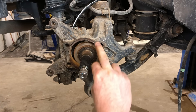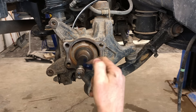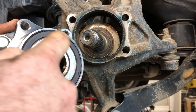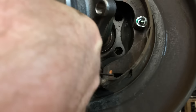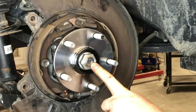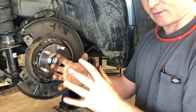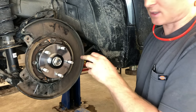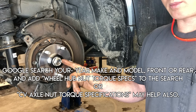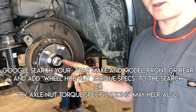Clean this hub out as much as you can, and then I like to clean up this flange right here so that you don't cause any alignment issues if you get a piece of rust stuck under the new hub. I like to use a little bit of grease — a little bit goes a long way, a dab will do you. This is the reluctor ring; it's built into the bearing. Go ahead and reinstall this bearing. Make sure you torque this down to the right spec because it helps ensure that the bearing lasts as long as it possibly can. The CV joint is actually what's holding the two halves of the wheel bearing together — this is the outer half, and the hub unit's got an inner bearing and an inner half on it. Spend a little bit of time on Google and look up the exact spec for your vehicle, and sometimes if you can't find it, you can call a parts supplier and they'll supply it with the bearing.